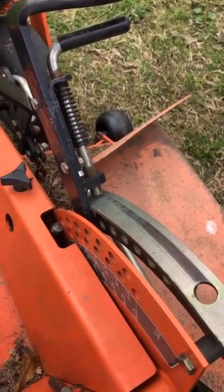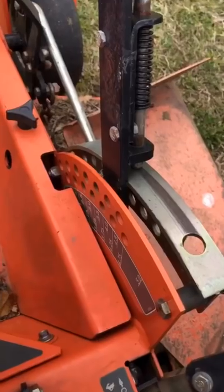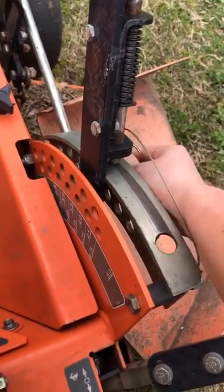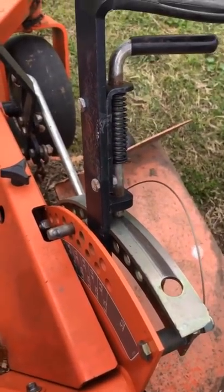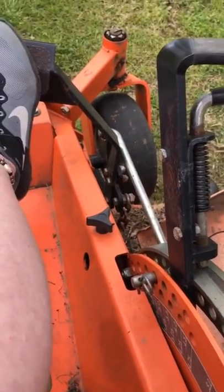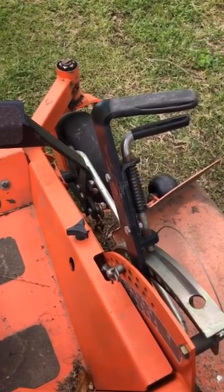My yard is pretty good, so we're going to do 3.0, just because it sounds cool. While pushing your foot on there, you're pulling that lever back. You're going to go just above the number you want to use. Since we're using 3.0, we're going to put this little pin right in there, just like so. Then take your pin and replace it so this sucker doesn't fall out, and push it down in there. Then you'll be able to let go of the brake. Voilà — your deck is properly suited to mow your yard. Do all of those deck-adjusting steps with the mower off, just for safety.